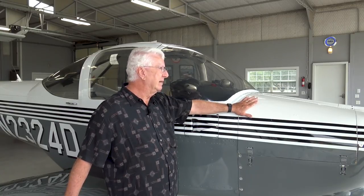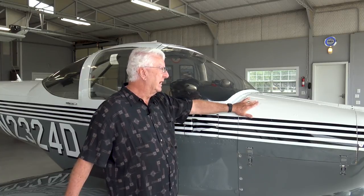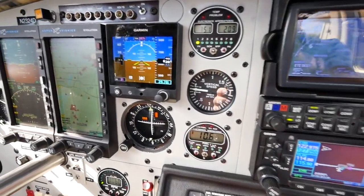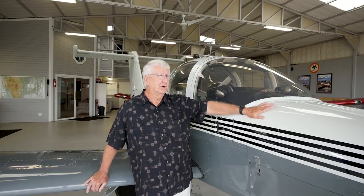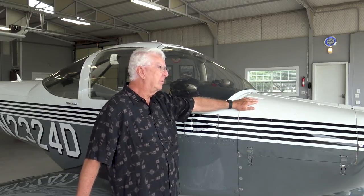Standard Tomahawks typically cruise about 95 to 97 knots. With this modification and a couple other little things I've done, I can actually cruise at about 112 knots, which is pretty good for a little airplane — burning about 7.5 gallons an hour, so it's really a very economical airplane. Currently it has about 2,400 hours on it, which is still real low time for this fleet. I put new interior in it, all new instrument panel from start to finish. I added an Aspen 1500 Evolution system, all the EI gauges for oil pressure, engine analyzer, fuel flow — everything that EI offered. And I recently just added a Garmin G5 to it.